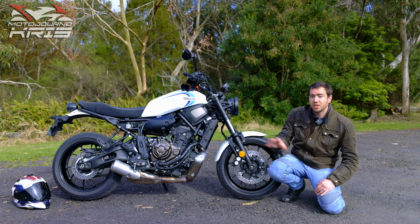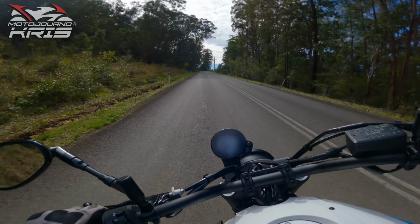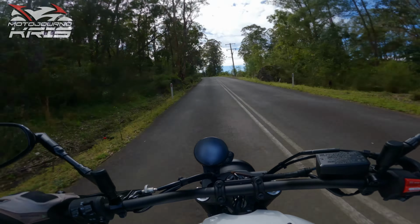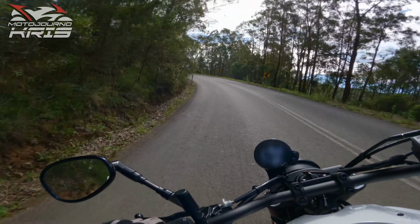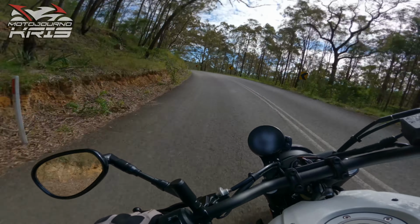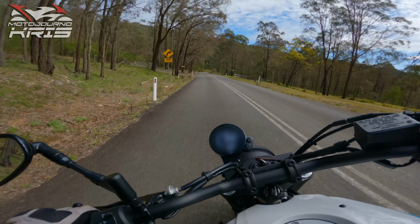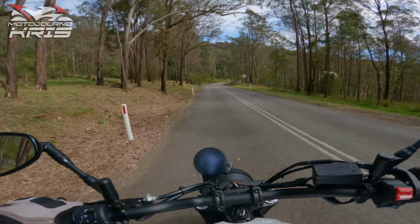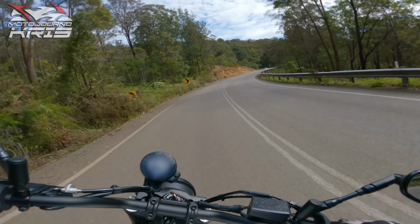The 270-degree crank parallel twin in this makes it sit somewhere between a fairly normal parallel twin and a V-twin in my mind. It's got a beautiful feel, a beautiful sound, really nice punch as well. It's just a little bit more lively than the traditional parallel twins, which sometimes get described as being a little bit boring. And certainly when we're talking about a 270-degree crank, I don't think that's a fair criticism.